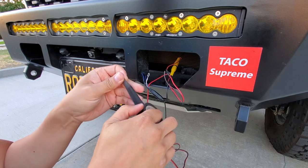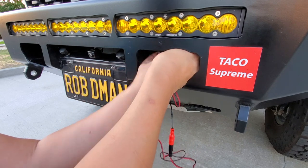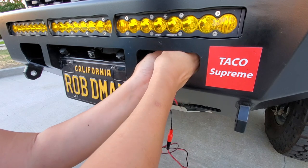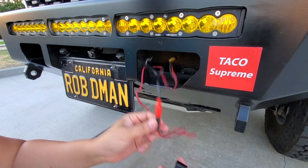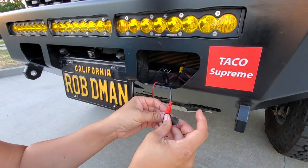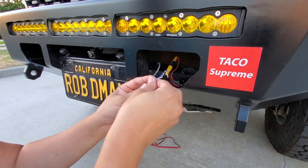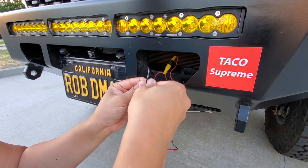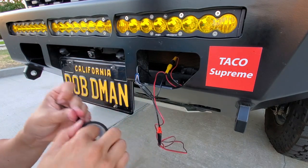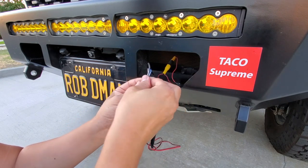Always make sure to cover any exposed wiring. I'll tape it just to be tidy. Let's get that RCA cable taped up, and lastly the power cable. I don't think this section carries much power — it's more of a ground — but let's tape it up to keep it clean. You can always use this later as a reverse camera by patching it back up with lines if needed.